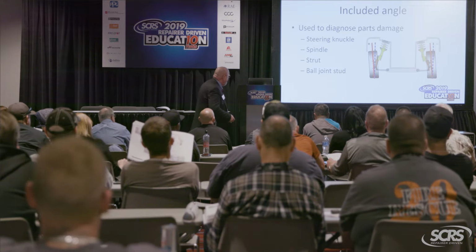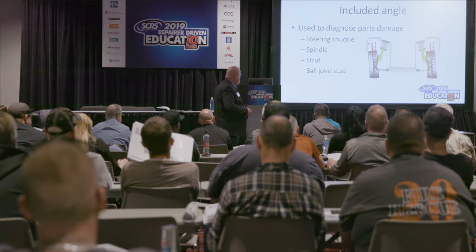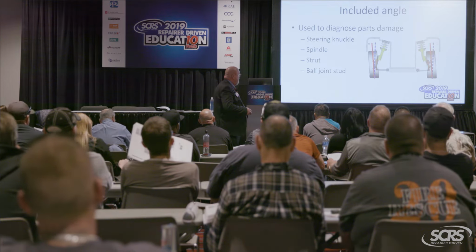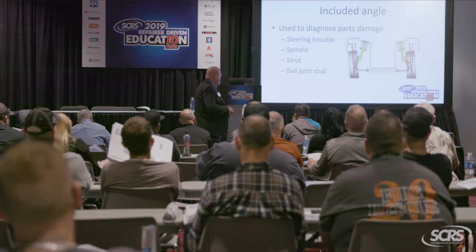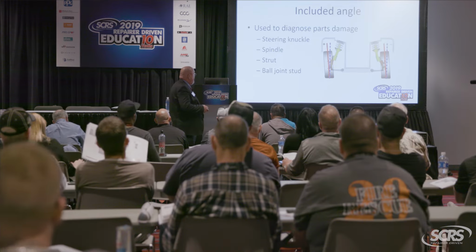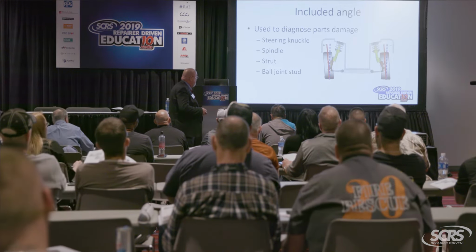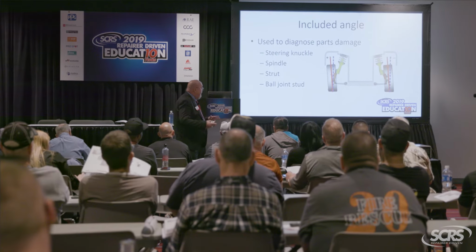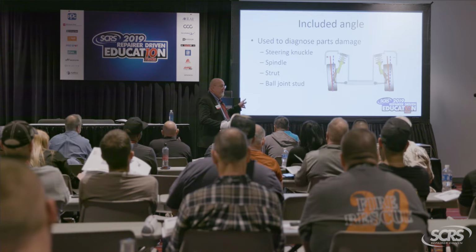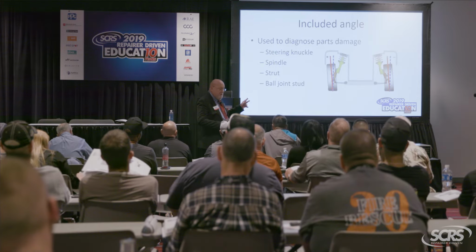Let's take a look at what we have. Again, I have a ball joint down here. What holds the ball joint to the car? All right, what's the lower control arm bolted to? What's the cross member bolted to? Okay, and then up here, we have that strut bearing, which is held with the strut tower, which again is welded to the unistructure. So in other words, to break it down and make it easier in your head, every part that's in the gray up there is your steering axis inclination.